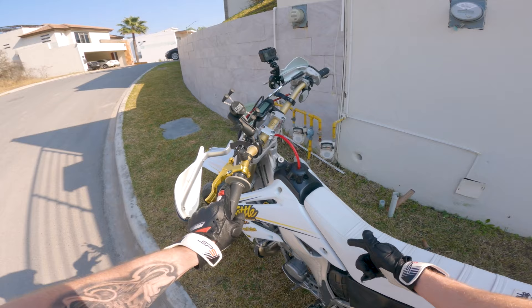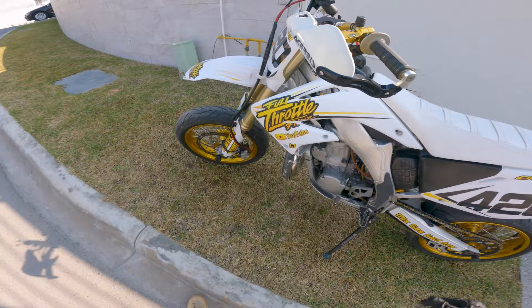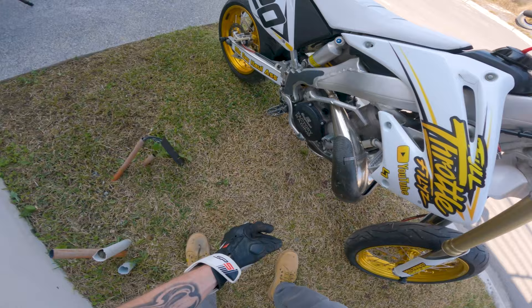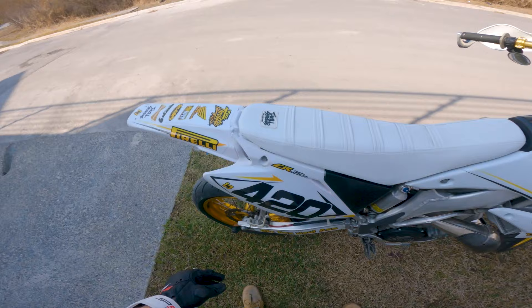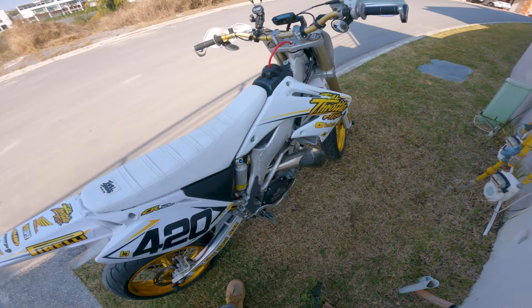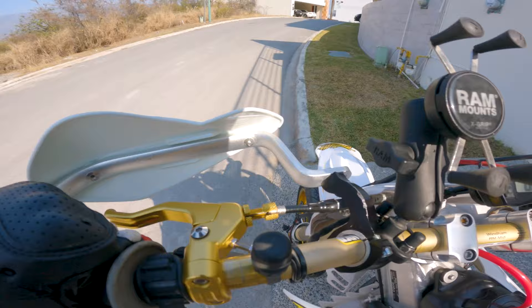This bike might look super fresh to some of you who are new, but it's actually got about 30 to 35 hours on it, about 1,500 kilometers, and it's starting to get a little beat up — shaking itself apart. Mainly I got to fix this pipe. I heard it yesterday rattling; these rubber seals have gone bad here. Also my rear brake caliper needs a rebuild — the seal is coming undone and the brake is a little bit sloppy, but it's working for now. Anyways, let's jump on this beast and get going.